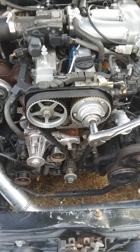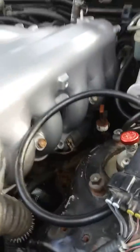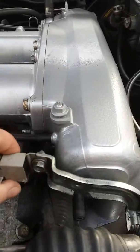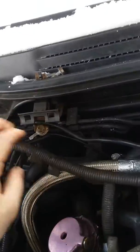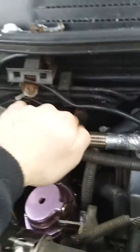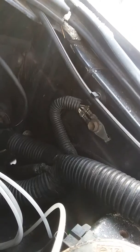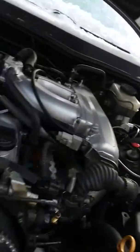Quick video to show what's happening right off the bat. I figure that this is a ground that needs to be put to here. I have my other grounds on the intake manifold and this might be a problem. Plus I don't know if this actually goes to the head or not, but that looks a little rusty. And that guy looks rusty as hell, which is a main harness ground I found out from the FSM.